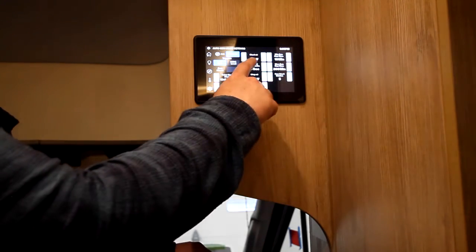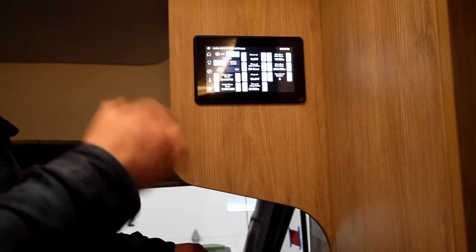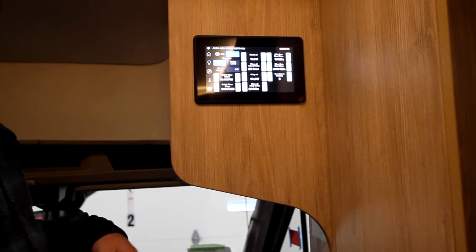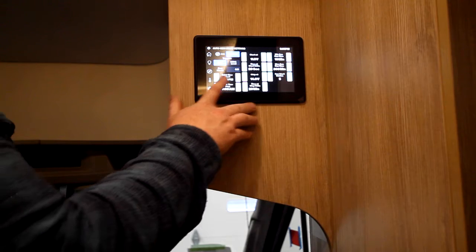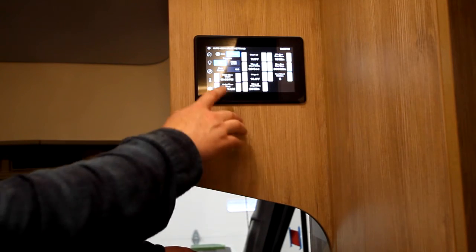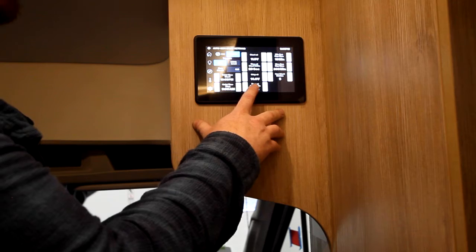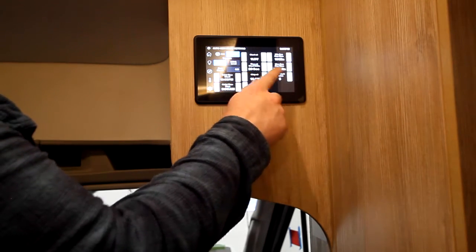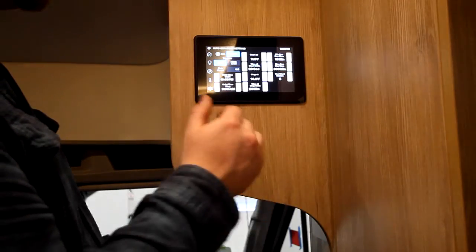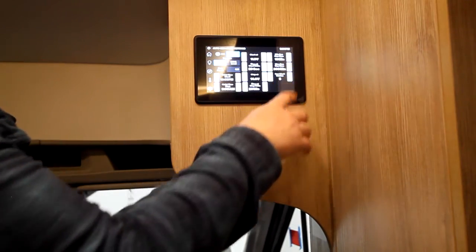We have our start voltage at 11.5 volts because with AGM batteries, they like high voltages — you go from like 13.5 down to 11.5 as the best voltage range. Then we have our quiet start and stop times — these are the times you set for it to not run, between 10 PM and 9 AM, in 15-minute increments. You can set that at whatever campground you're at. Our time to stop volts is 20 minutes — it has to be at 14 volts for 20 minutes for the generator to stop. And it has to be at 11.5 volts for 20 seconds until the generator starts. The maximum generator runtime is 300 minutes, and the minimum is 10 minutes.